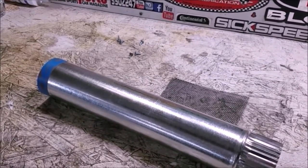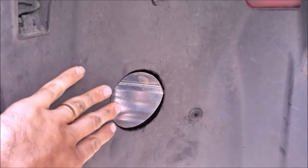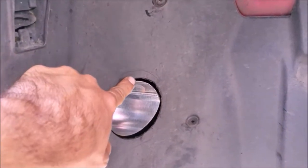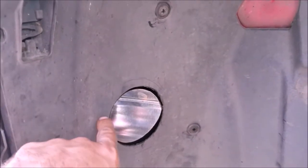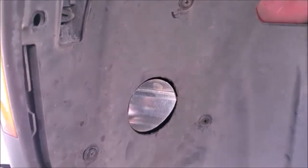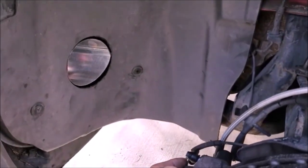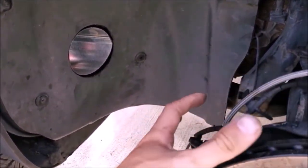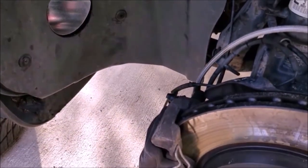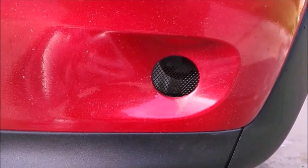Here's a glimpse of the finished product — the tube is perfectly flush with the liner. I used a three and a half inch hole saw to make this hole, and it lines up almost perfectly. All the air is going to come from the front bumper into the wheel well almost in the same exact spot as on the E39. It should be directed almost directly at the back of the caliper and should do a really great job of keeping our front brakes cool at the track.